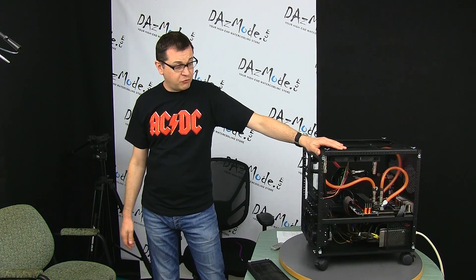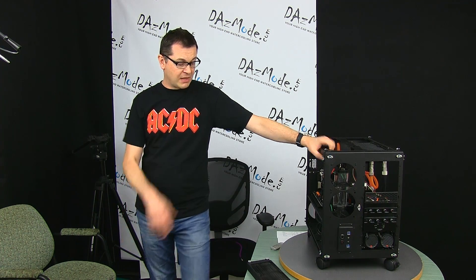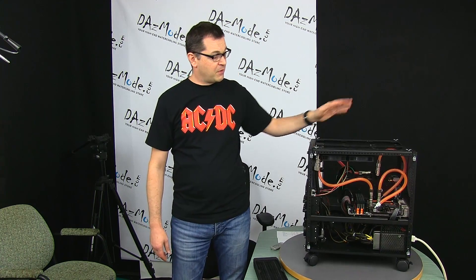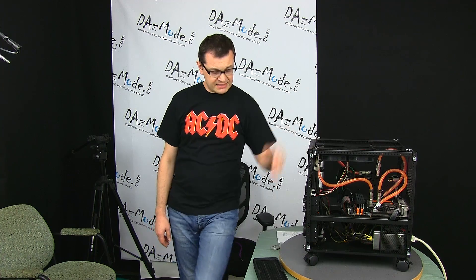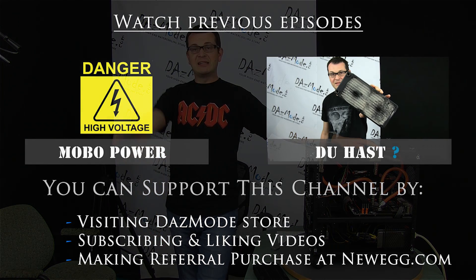If you run a silent system with very slow fans, dust actually becomes a big impact, so keep that in mind. Those of you running fans at high RPM probably don't care as much, but if you run a silent system I strictly recommend cleaning your system first, and second, try to avoid high-density radiators — that will give you better, longer-lasting performance overall. I hope you find this information helpful. Next, I'm going to test this high-density FPI radiator against a medium-density radiator from Darkside LP, which is about 16 FPI versus almost 20, to see if high-density radiators really buy you as much performance as some manufacturers claim. See you soon!